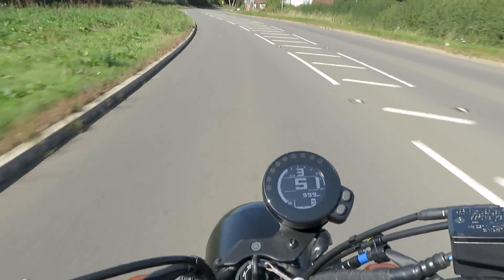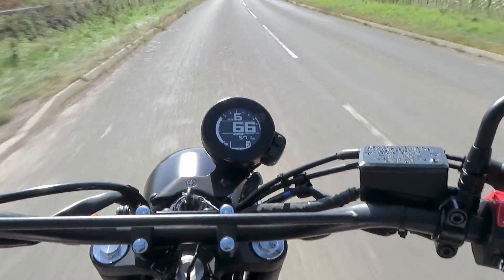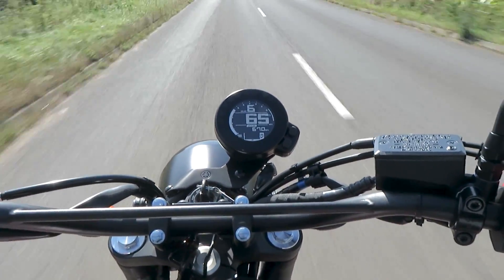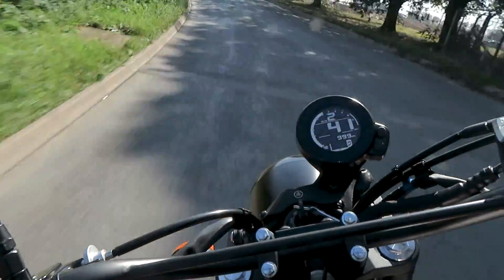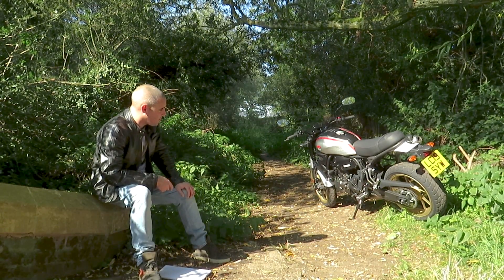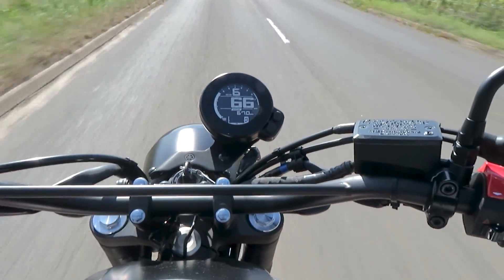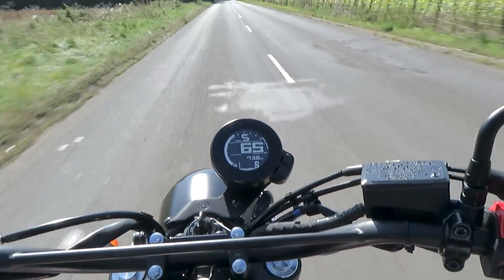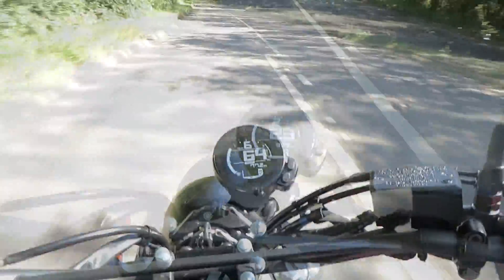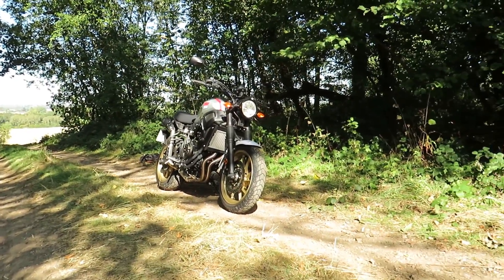It does feel a little bit underdamped but for this kind of bike you don't want it rock hard. It is quite soft and does dive quite a lot on the brakes, but it's very predictable — no surprises whatsoever. It does corner quite well, but bumps mid-corner will start to unsettle it, and above motorway speeds it will tend to get a bit of a speed wobble that builds if you back off. I haven't quite put my finger on whether it's the suspension or the tires causing it. You've got 130mm of travel on the front and 130mm on the rear — don't let the off-road appearance fool you, it's basically the same as an XSR 700 with some semi-knobbly flat track style tires. You can take it on a little dirty dusty track or byway, but anywhere near mud it's just going to get stuck.